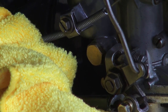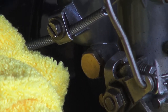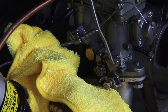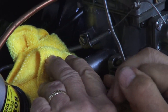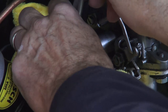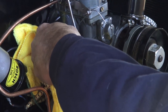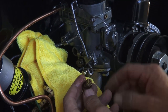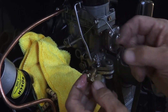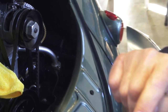In the worst case scenario you'll have to take the carburetor off to get to the main jet. We're using a deep socket — you could use a regular socket too, but this is what we have handy — 14 millimeters, or if you have domestic sizes, 9/16 also works. Just crack it loose. The fuel is starting to come out, and only the fuel in the fuel bowl will come out at this time. Here is the seal that seals the plug against the carburetor, and here is the plug along with the main jet.